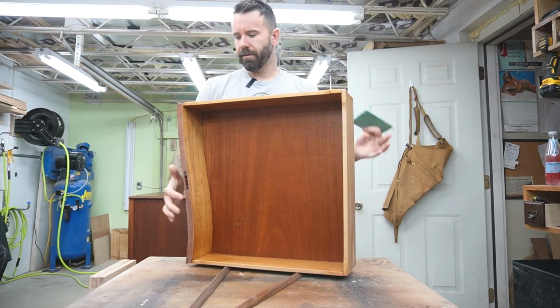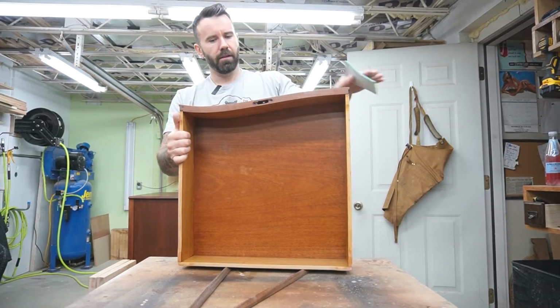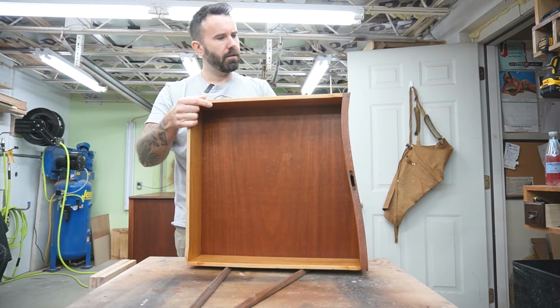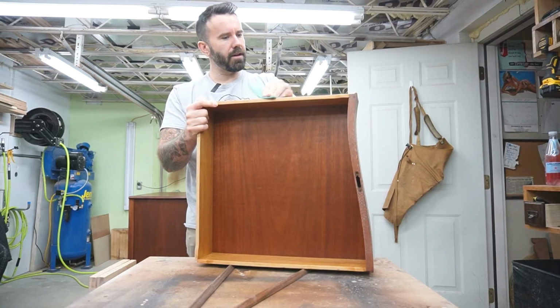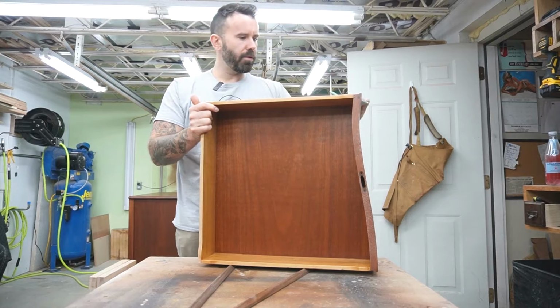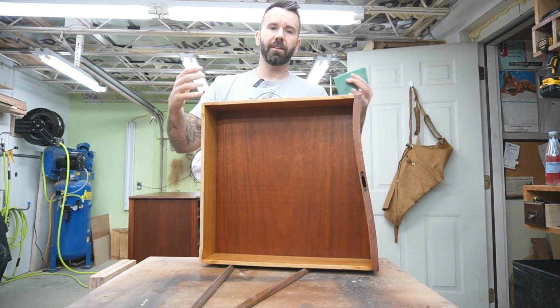So I gotta get everything else, and then get on to the top coat. Same thing with that, mix it up with the thinner. Probably won't put any retarder in it because that slows down the dry time.